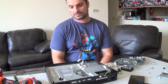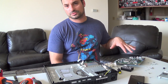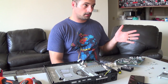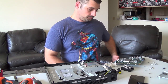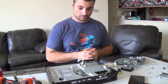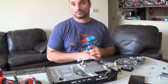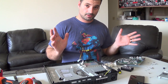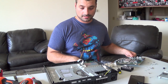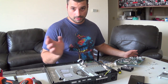My current PS3's drive was messed up, and I put this replacement one in and it still didn't work. So if I'm able to get this machine to work with my old Blu-ray drive and it works, then I know it's the motherboard — most likely the ribbon cable is bad. We'll see what happens after we bake this and put it back together. Happy gaming — maybe buy a PS3 on eBay and tinker with it, have a little fun. I'm gonna go into the kitchen and I'll see you guys later.